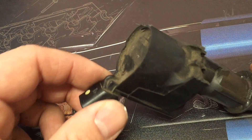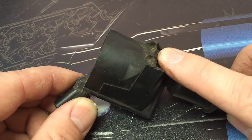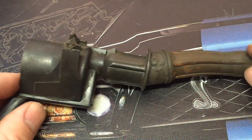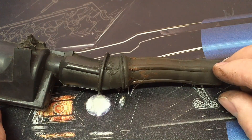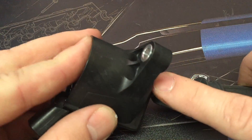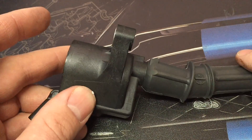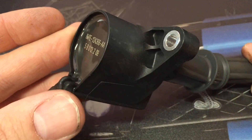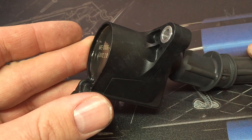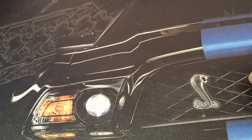This may look familiar — this is where it's going to break off on the coil where it mounts to the intake manifold, from the plug blowing out and forcing the coil up and out of there. It breaks at the weakest point, so you need a new coil. I only recommend the DG 508 from Motorcraft. If you buy them on Amazon you can pay about $40 instead of about $75 at the dealer.